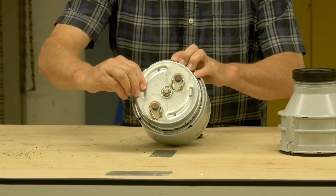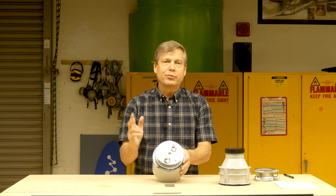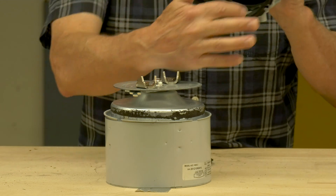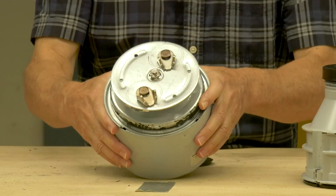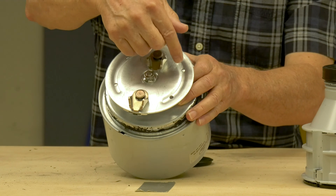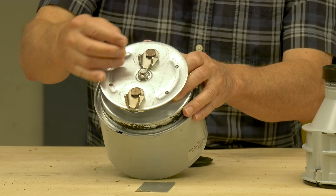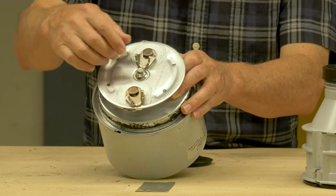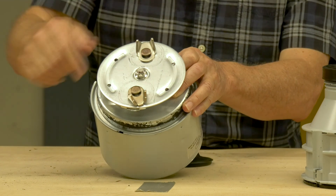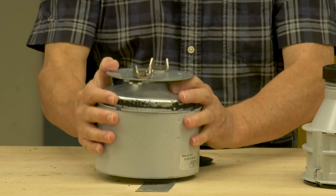When the motor is running, this platform spins. This particular garbage disposal uses centrifugal force in three different ways. The first way is that when this platform spins, it throws the food outward against the grinding ring. The second way it uses centrifugal force is when this platform spins, these paddles are thrown outward so any food that gets stuck gets whacked by the paddles. You don't want them to be rigid — if there's a solid piece of bone you don't want the plate to jam — so they're flexible and knock out of the way easily, but they're always thrown outward again so they'll hit the food next time around, and eventually the food gets ground against the grinding ring.